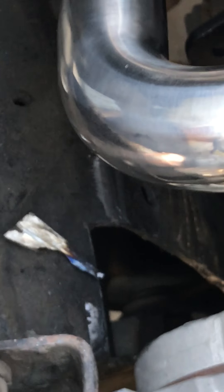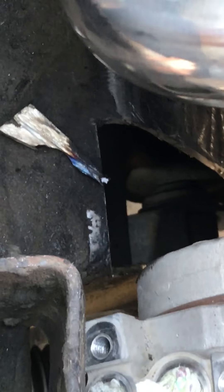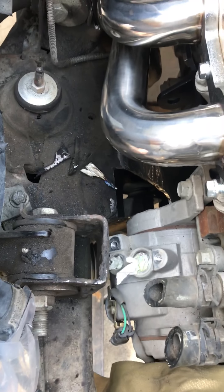This is all just for mock-up — we might even put a little dent in the header. We did lower the rack and pinion just an inch; I don't think that's gonna hurt with any bump steer problems. What that did is give us a little bit of gap between the rack and pinion and the engine, so we got it down low enough.